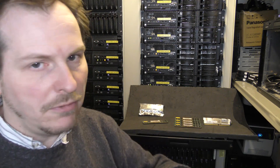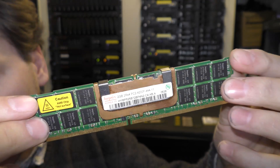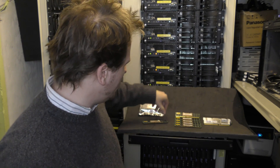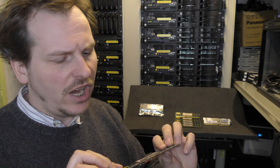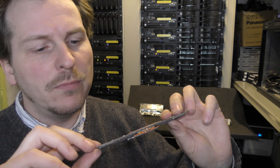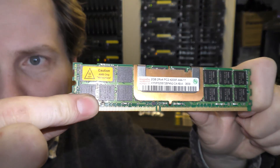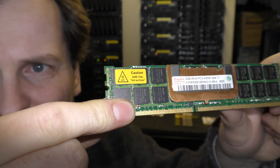And then there are six of these. I've never seen a memory block like that, but apparently that's a block. I was going to play with these and put them in, but then I found that one of them is a bit dodgy. If you see the capacitor at my finger, it's not supposed to be up there — it's supposed to be further down. I'll go down and see if I can solder it in place or maybe just use my heat gun and tap it along with something.